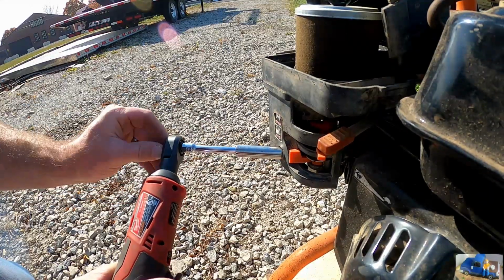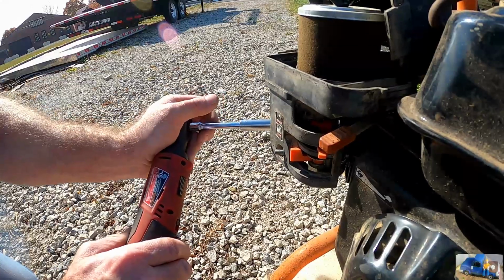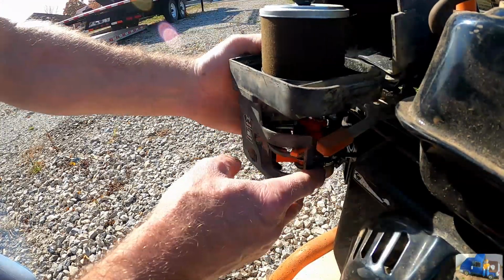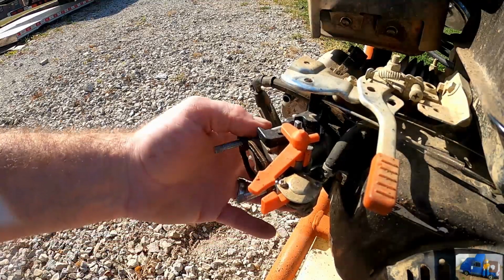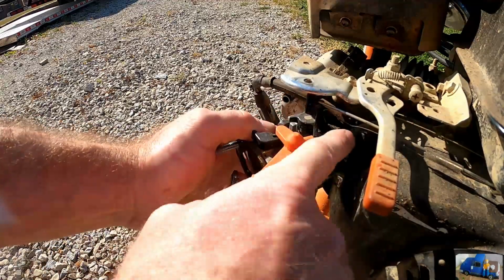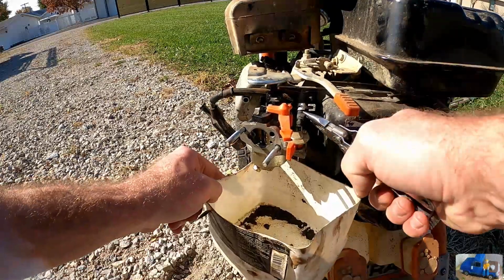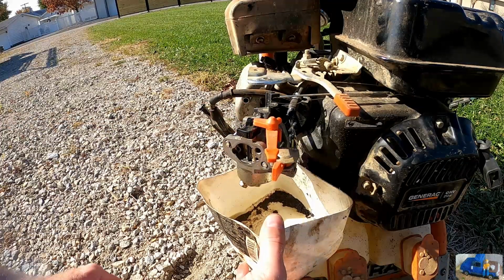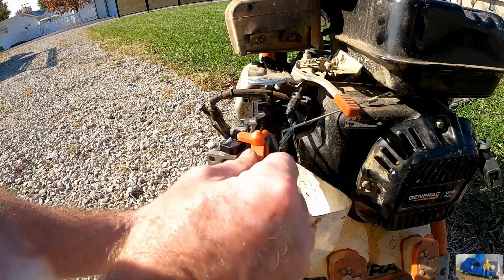Get this carburetor off here. Nice. That cover slides off of there, and then the carb slides off of these two studs sticking out here. You just have to disconnect the fuel line and then the linkages here. Got our old trusty catch bin here. Use that to catch all that old fuel. It probably needs, not probably, it needs changed anyways. So then we have this little spring wire here, and then the governor. And this carburetor should just slide right off.